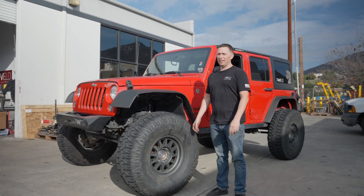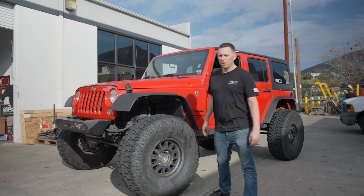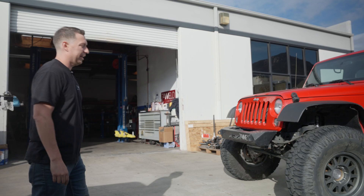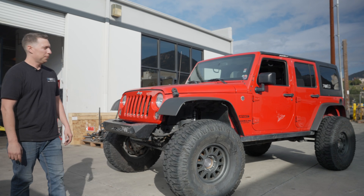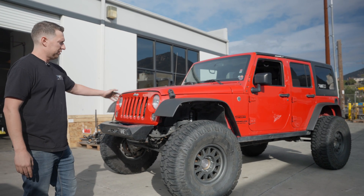As I mentioned, it is pretty bare bones. Just did a nice little fender chop here, but I wanted to show what it ends up looking like with just an inch-and-a-half leveling kit. These are JK factory axles with 5.8-inch backspace wheels and 13.5-inch wide tires. It doesn't end up being super tall or super wide — you just get a lot of ground clearance in the middle.